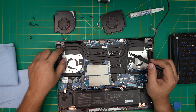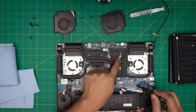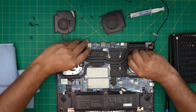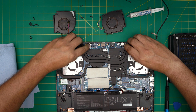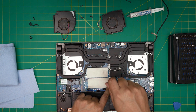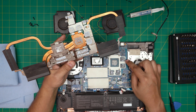Now we're going to remove the heat sink. First remove the screw on the corner — those are the tiny screws. Then remove the four screws for the CPU and four screws for the GPU. Once removed, don't yank it up from the edge — grab it closer to the CPU and GPU and gently lift it up. They are using a thermal putty right on the VRAMs.